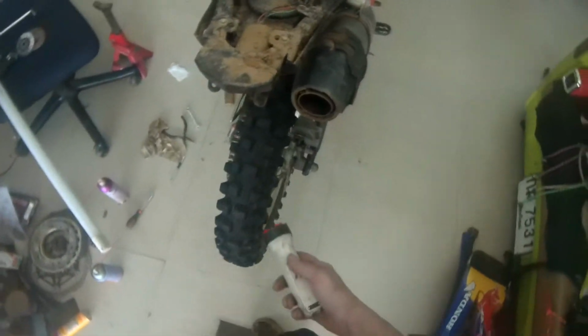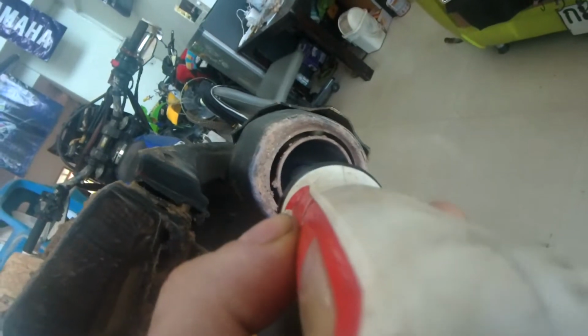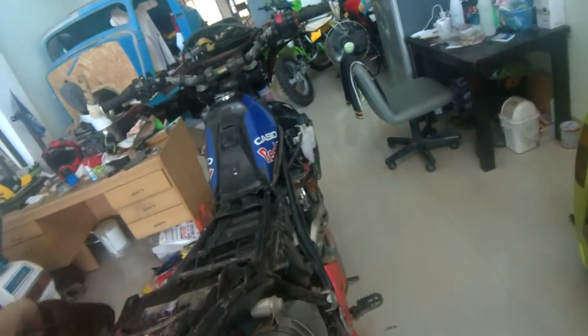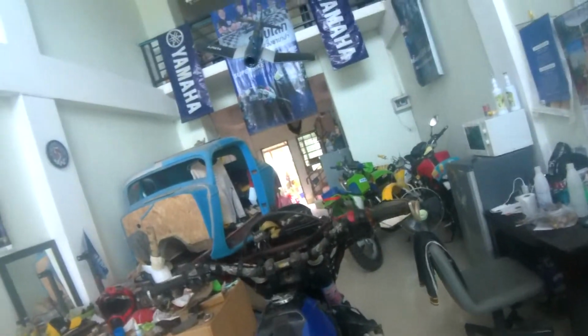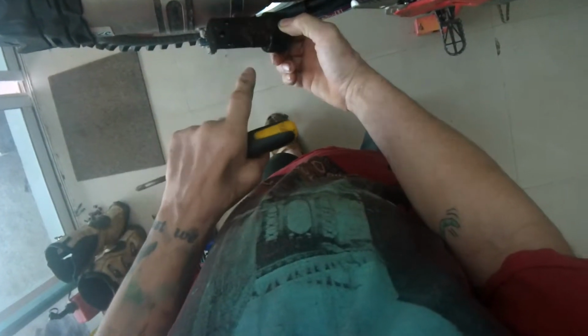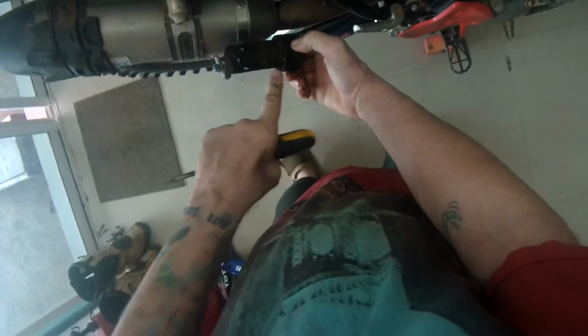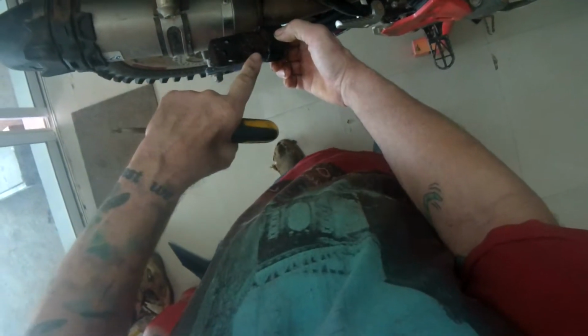So if you want a quiet can, or a quieter can, you're going to have to modify what you've got. Now, I'll tell you what I will do. I'll take this off my head, because then I know it's pointing in the right direction. Can you see in there? What we've got in there on the base tube that goes inside, we've got a blank, and then I've drilled some holes around it. So your primary waves come hammering into the tube, they hit a dead end here, and then they're forced to come back out through the sides.